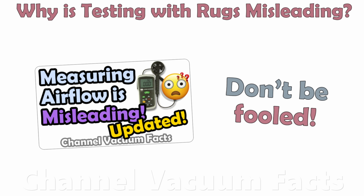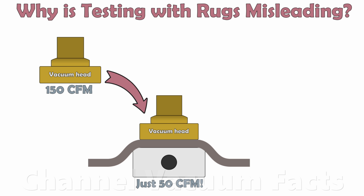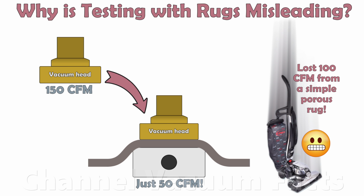To help understand this by example, Kirby machines are often bragged about because of their high airflow at the open hose. But amateur videos linked to in the description show that simply putting a porous rug that offers hardly any airflow resistance under the cleaner head can reduce a 150 cubic feet per minute airflow to just 50. The tiniest resistance cuts off most of the airflow, yet this goes completely unnoticed. Even the brush roll apparently costs the machine 6 cubic feet per minute. You can imagine how much more would be lost on a highly resistive fitted carpet with waterproof backing. High suction prevents this scale of relative loss when it matters.